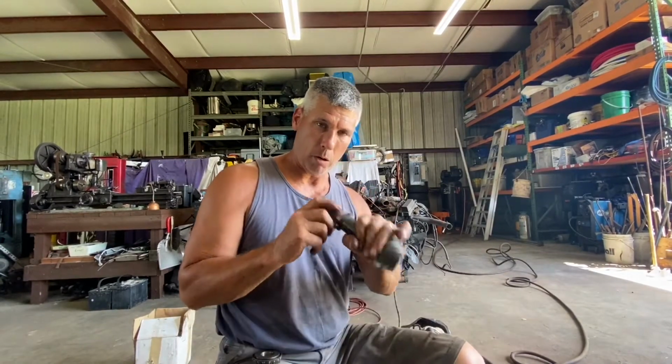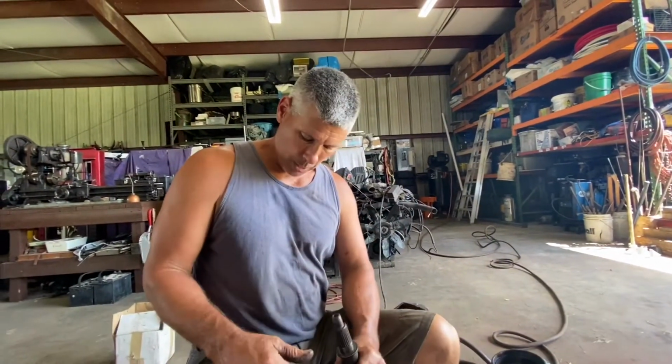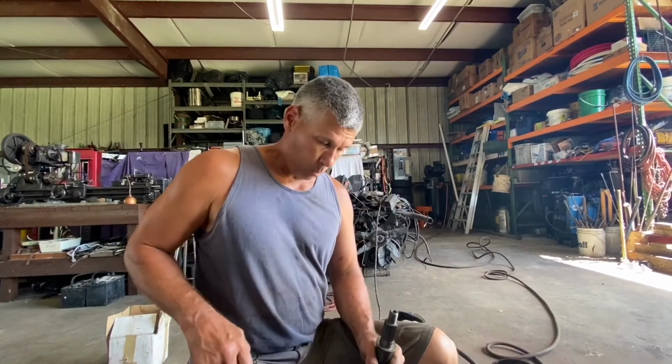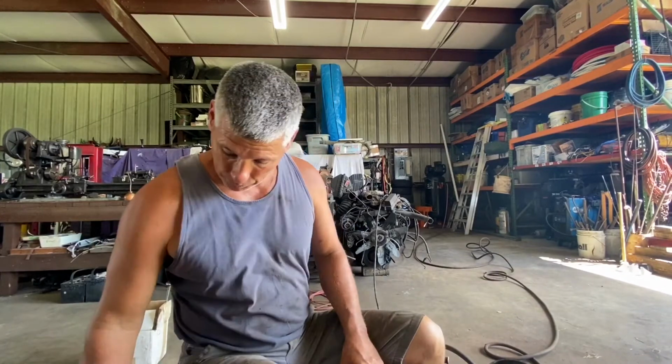Now, that's why, since all these bearings are press-on except for the outer here, you make all your bearings and races to where they will slide in and out by hand. You hog them out, grind them off, and you have a sacrificial set of bearings. I always use a used bearing. Of course, there's going to be a little bit of differential between that and a new bearing, but it actually works very well. So then once you get your shim stacks all figured out, then you just slide them off and you press your new bearings on, you put it together, recheck it, and I've never had it not be right there. So we're gonna get started on this. I'm gonna drive that inner race out, and I gotta hog it out. I gotta keep the shim stacks together, obviously, and get started.